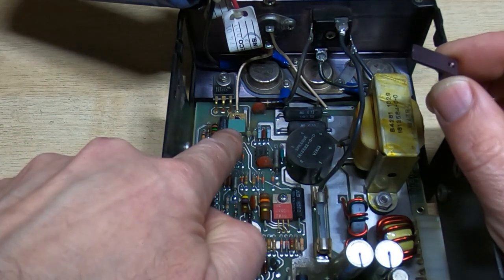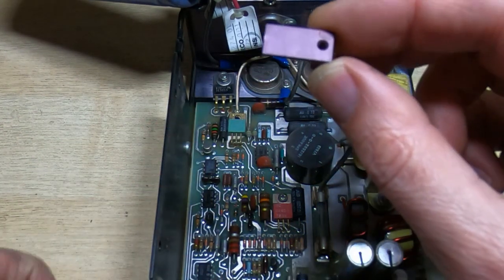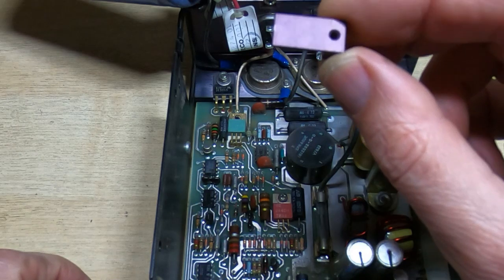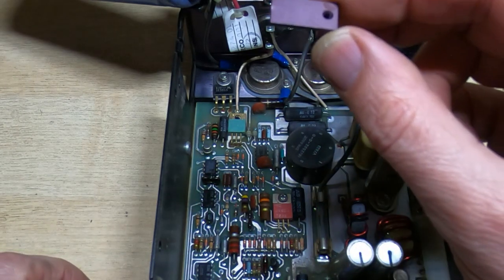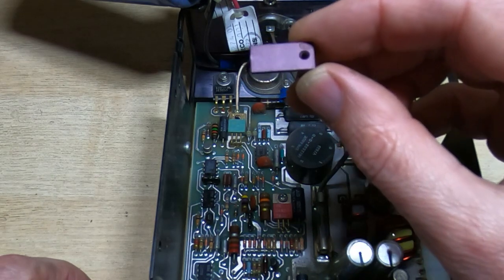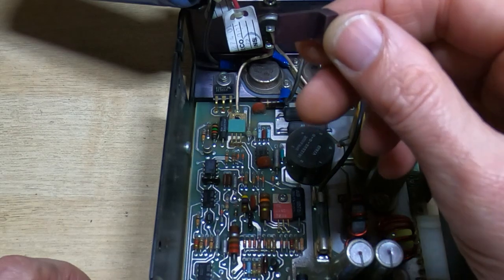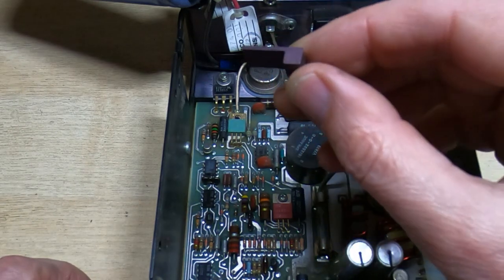This is the device we're trying to keep cool — the green one. I'm going to make a replacement and I'll do the same thing for the other 5V supply. The minus 15V supply I'm not going to do anything with — that tends not to have the same problem. I'll go and get a couple of these made up in the workshop and show you how they turn out.